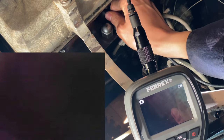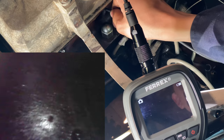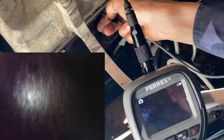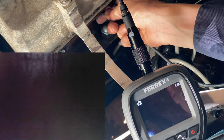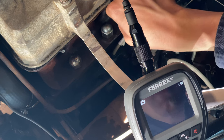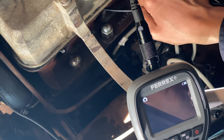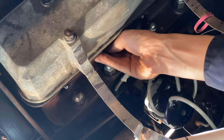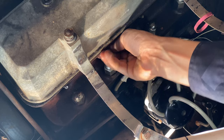I can see a little bit of scoring down there, unless that's a honing mark. That's definitely the top of the piston — there's a little blob in the centre. Doesn't look too bad. I think most of that gunky stuff will be a combination of oil and soot. The main thing is there's no huge soot deposit, and there aren't any large holes as far as I can tell. I think we'll have to get the engine running and see how it performs before doing anything too in-depth. That didn't yield anything particularly exciting, but it does show that there isn't a complete mess inside the engine.